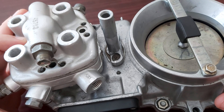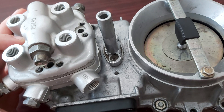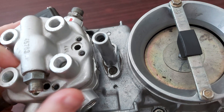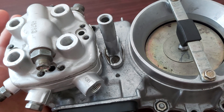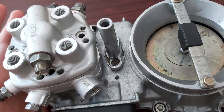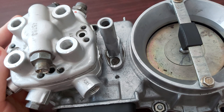When you're done with all this and when you get the plate where it has to be and put it back, you will have to purge the air out of the system — out of these four. Be aware of that. If you just put it back, screw all the screws back, and start the car, it won't run as it should.